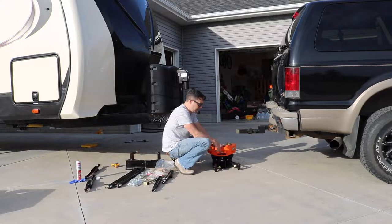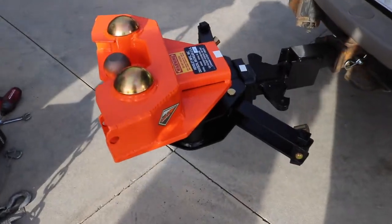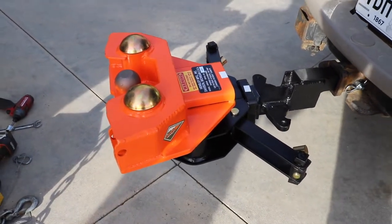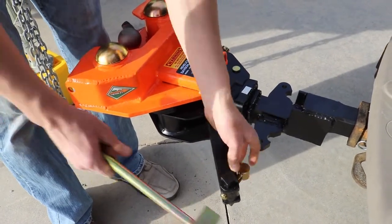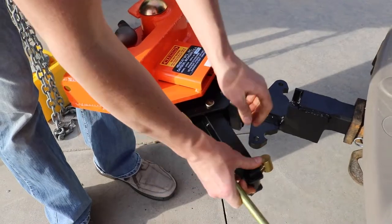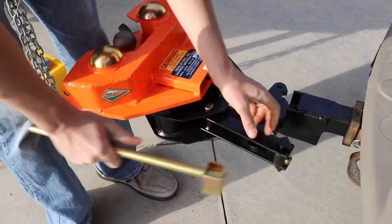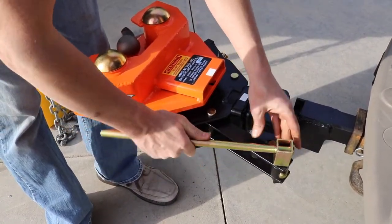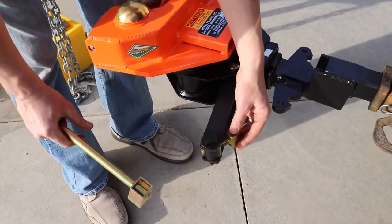The first thing you need to do is make sure that the hitch box is in line. They have two stickers here — make sure they're aligned correctly, because when you slide it on the stinger it'll go on there a lot easier. Now that we have the hitch box on the stinger, we need to pull these over-center latches towards the stinger and secure them in place. For ours they're a little too tight, so you can loosen them up just by rotating them.